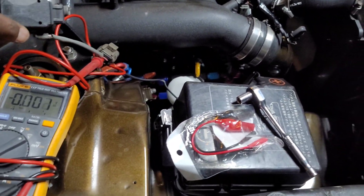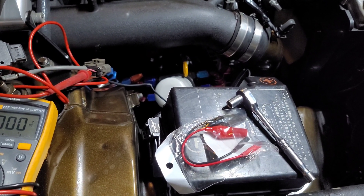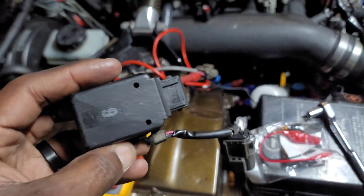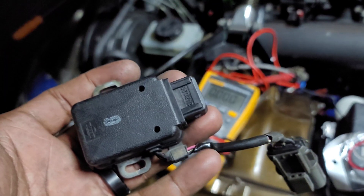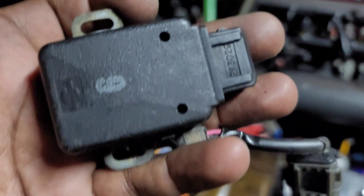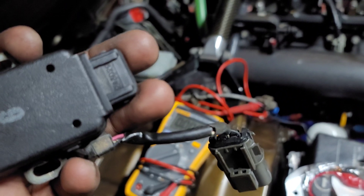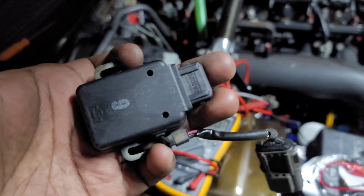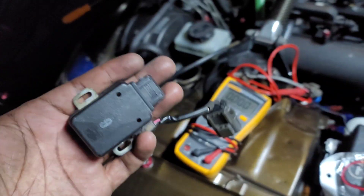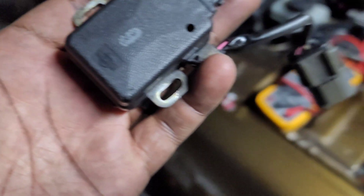I checked this sensor against the one I'm going to use, which came off another engine. The old one — I can get the voltage down to 0.4V at idle, but going up it will only go to 3.89V, and it's supposed to go higher than that. So we're going to try a different sensor. If that fails, I'll get a new one from Nissan — they were like 80 bucks. For now, the old one is going in time out.